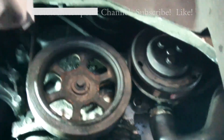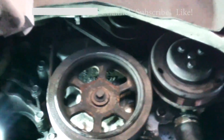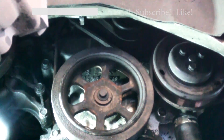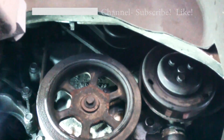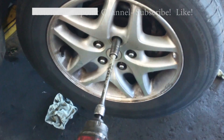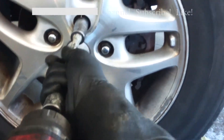The belt is back on. One note: take some water and pour it from above to rinse all the antifreeze off the pulleys before you put the belt on, as I mentioned about getting squeal from antifreeze-soaked belts. Put things back together — the shield on, the tire on. Tighten down the wheel in a star pattern. We have a torque stick here that torques to 100 foot pounds, which is what you want.